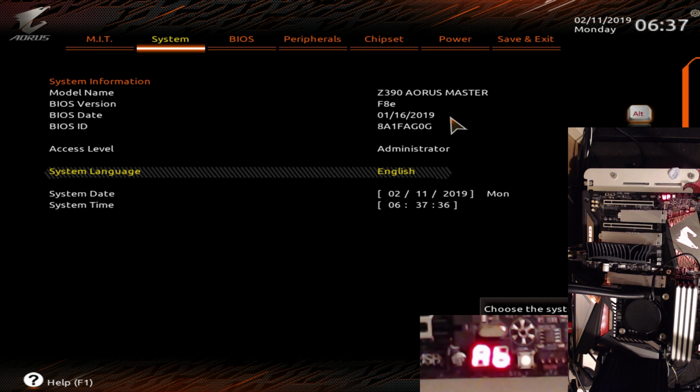Because this board's been absolutely great for me. If you've been following the YouTube community section of my channel, then you would know that I recently posted a screenshot of this motherboard doing like 4560 megahertz on the memory, with not completely garbage memory timings. Admittedly, that's just for benchmarking purposes, and ultimately the difference between daily settings and benchmarking settings is just how much stress testing you go through and what kind of voltages are tolerable. But I don't consider it that different, though admittedly that was not stable settings. That was just, hey, this works, this even posts. And actually, in terms of just posting, I've had the board all the way up to like 4666 megahertz.